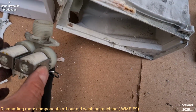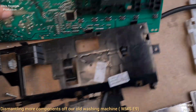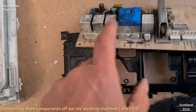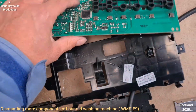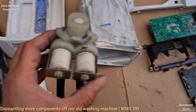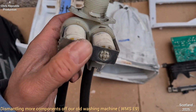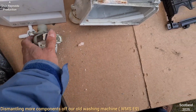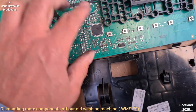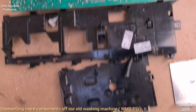That will then say to the solenoid to close. It will shut the water off by cutting the power, and all the high voltage stuff will be controlled with these relays in there, I guess, because it's the actual muscles, the actuators. These will use high voltage, you know, mains voltage, well, certainly higher voltage, because it's got work to do. It's actually got mechanical movement to do. Whereas the microprocessor will just use very small voltages and small currents because it's just a microchip.